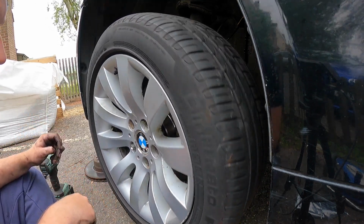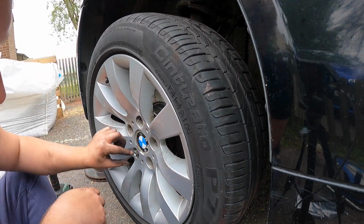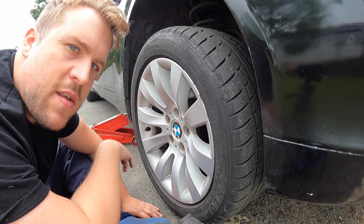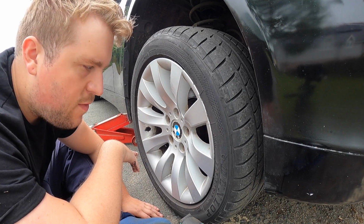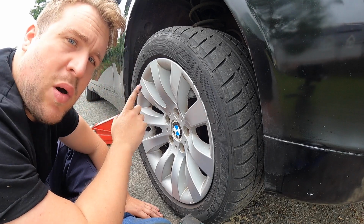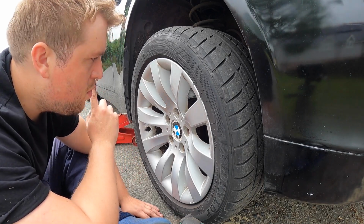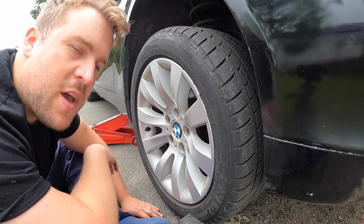One disc done, one pad done, one sensor done. Drop it down, torque this side up with manpower. So yeah, you guys aren't going to want to watch this again. So part 2 of this vid will be, it was going to be brake fluid flush and bleed, but I think the pond is probably more important. So I'll show you guys how to locate the drain plug behind the arch and also up there, and we'll clear it. That's really important.